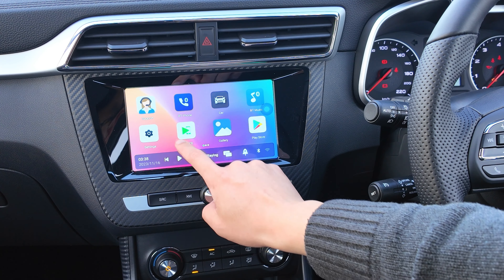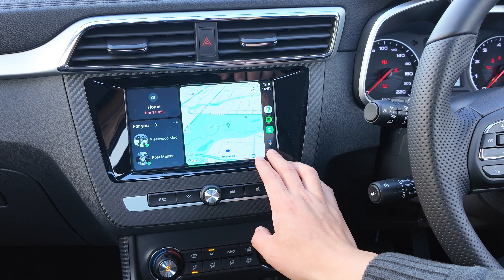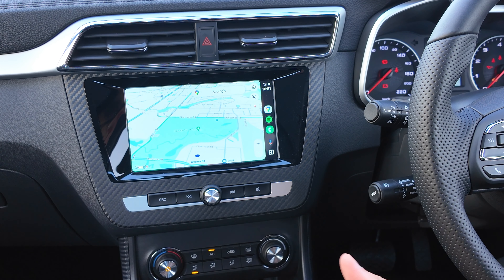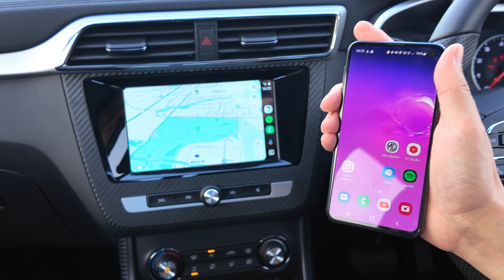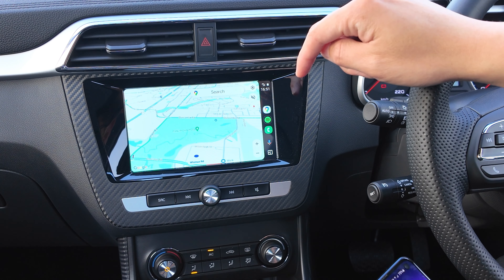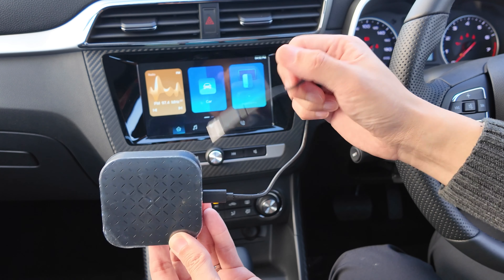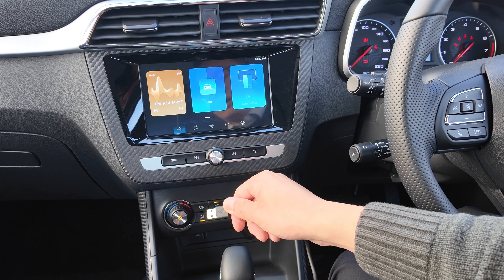For Android Auto, we just need to click Auto Link. When the phone is connected, it will show Android Auto straight away. You can find Google Maps and other things on this screen, with your phone sitting further away from the console with no cable connected at all. Going back, that's the home screen. In the next part, I'll show you how to connect from the start. First, connect your USB-C to the unit and connect the USB-A — the large port — to the USB port down there.